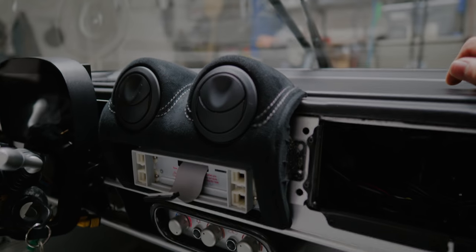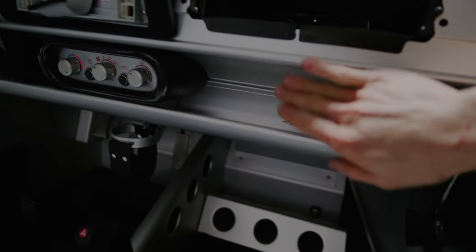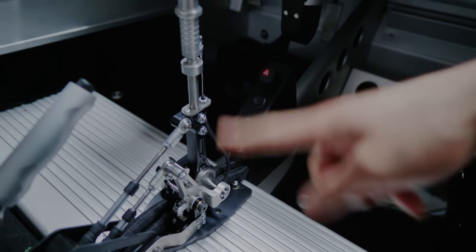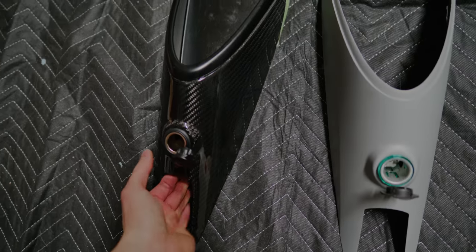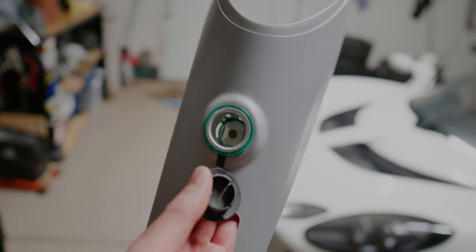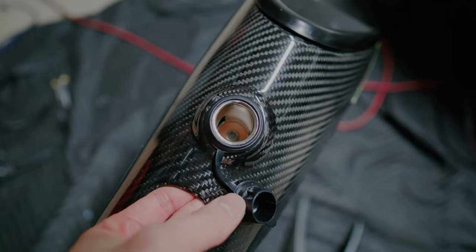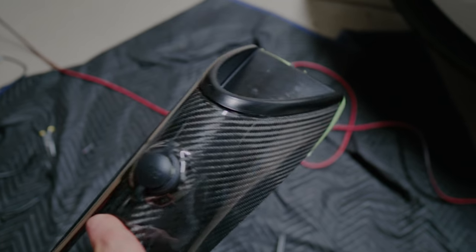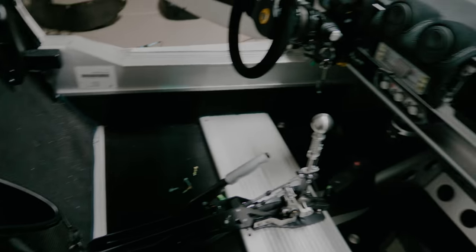You can see that from just picking good materials inside your car, you really elevate the sophistication and high-quality feel. Alcantara here, aluminum everywhere else in terms of the chassis, carbon fiber, more aluminum — it all blends very nicely. I'm now working on the new carbon fiber binnacle that goes in between the seats on the back panel. I got a brand new cigarette lighter adapter because the stock one is all plastic and flimsy, and the receptacle isn't even the correct size for U.S. plugs — Lotus maybe forgot to switch it over. I bought a new one and had to dremel out the hole slightly, and now this one is all ready to go. Here's the binnacle installed — another nice detail to the interior.